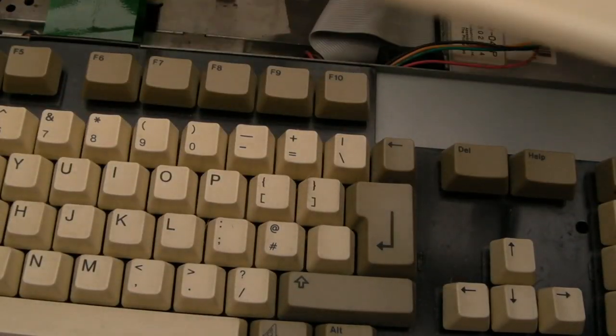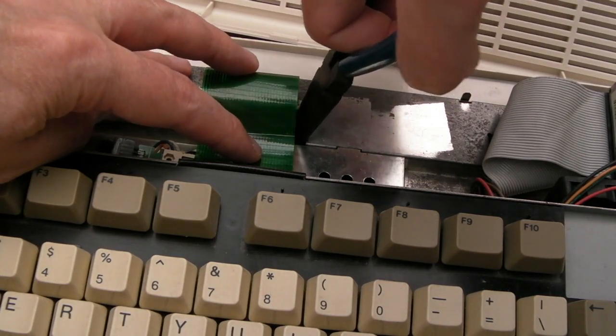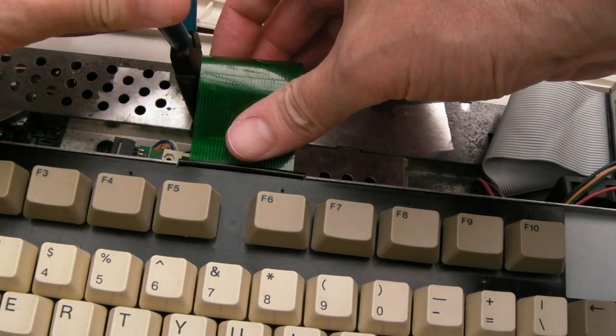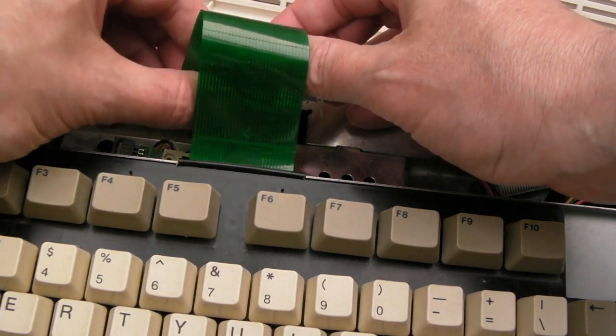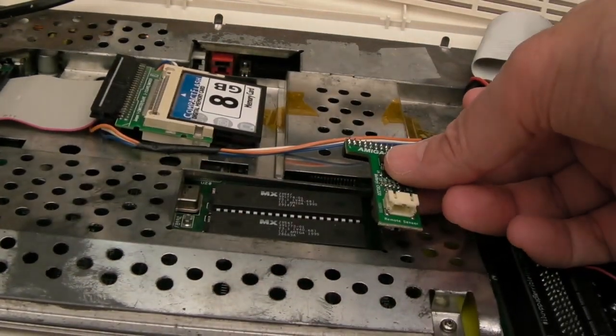Because I've been using this with the TF 1260, I've had the lid not screwed on, so I'll just keep using it that way. I've put all the screws in a bag so I can get in and out easily to change things like the compact flash card. We will have to disconnect the keyboard and everything. The easy way to get the keyboard out is to use fine nose pliers and lift the hood — this side is always really problematic, you have to straighten the ribbon a little bit — then very carefully pull the ribbon out.